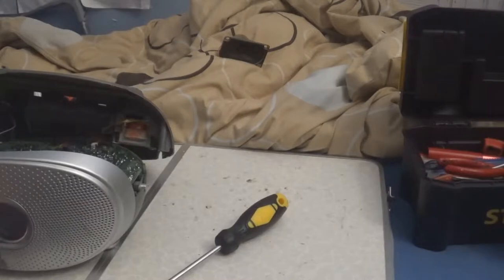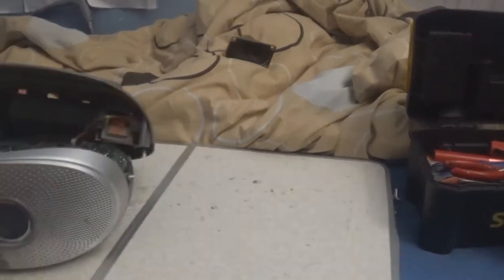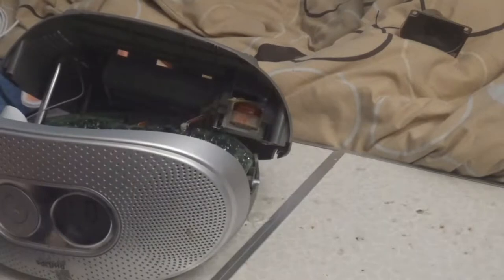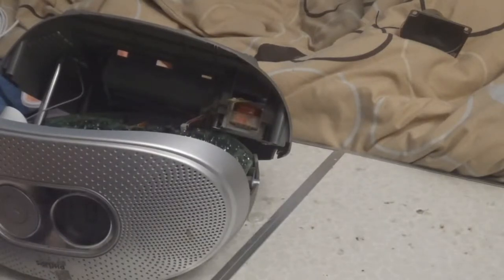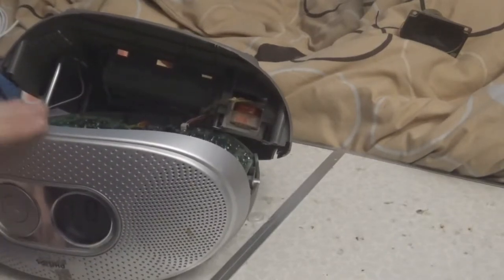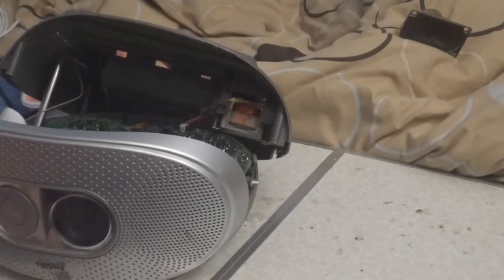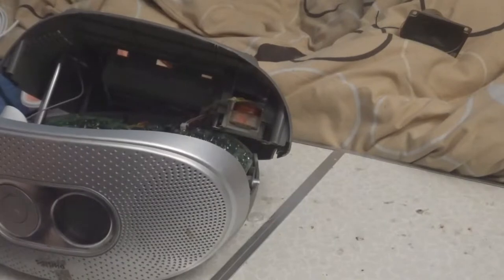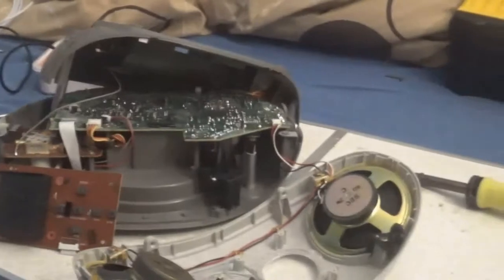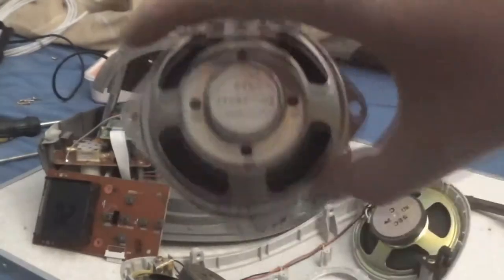I'm going to insert a disc. After some investigating — obviously can't play any music, I'll play some NTS on it once it's done — but this speaker's working and the other one is shot. There are some screws to take the front panel off, which is good. It's spinning a disc at the moment, but I'm going to isolate the power so I can do that. After identifying the issue, this speaker's blown, and I have a three-watt replacement for it.